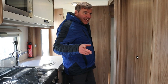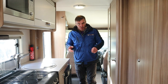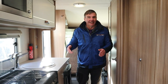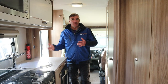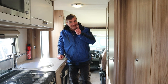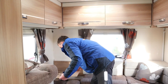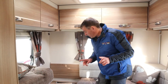Another question I've had is: when you prime up — that means filling the hot water tank up — will you need to refill your fresh water tank? It all depends on how much water you put in your fresh water tank. If you filled it full and you're priming up your hot water tank, then you're going to be 10 litres down. So obviously you would have to replace that, but it depends how much water you use when you're away. You really need to get to know your van. But it's the time of year that we should be draining down.